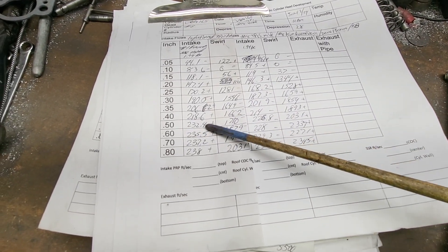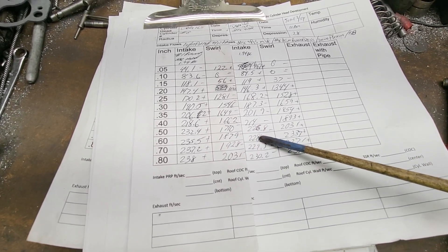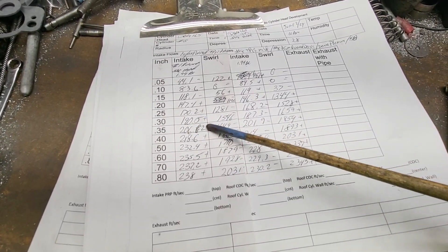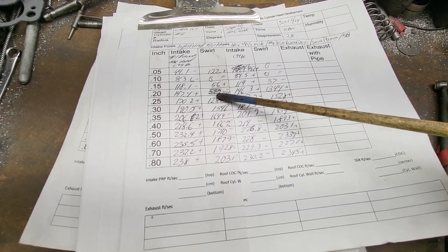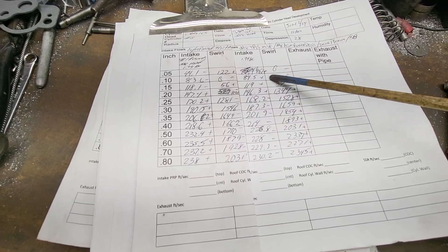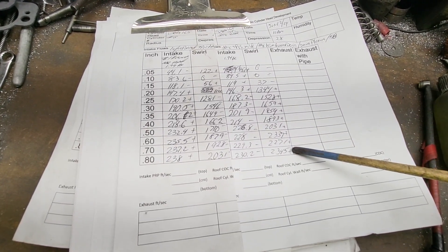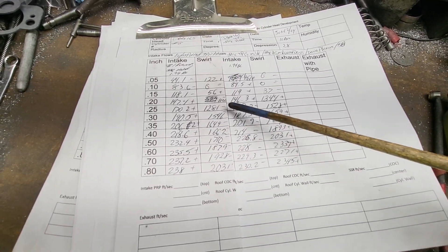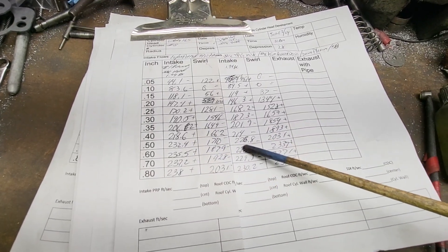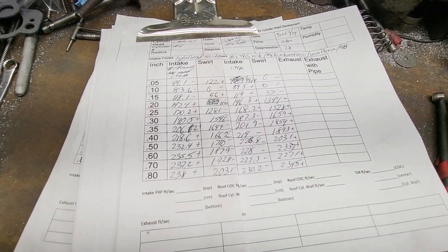If we take a look at our flows, we got plus, plus, plus — it actually works better at the lower flows, but it's all minuses up here. Is it too far out of whack? It's a little bit less than I'd like to see. At 300 it's not bad, it's pretty close. What is interesting is if we compare our swirl numbers here to our swirl numbers here — we only have a few spots that are minuses or equals — we have more swirl everywhere. So the question is, do you guys really think there would be much horsepower difference between two cylinders being fed like this? You guys can answer that in the comments — I know what I think.